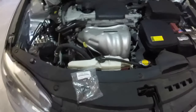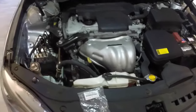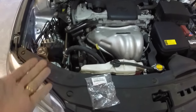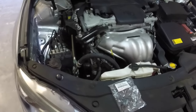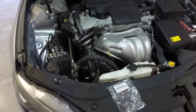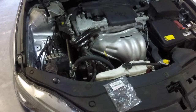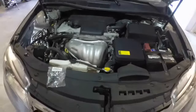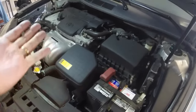The reason I'm going to change the PCV valve is because last time I went to change the oil on this car — and this car has 60,000 miles — I noticed that it was about a quart and a half low, lower than it should be. I know every engine is supposed to burn some oil, but that just raised a little bit of concern.